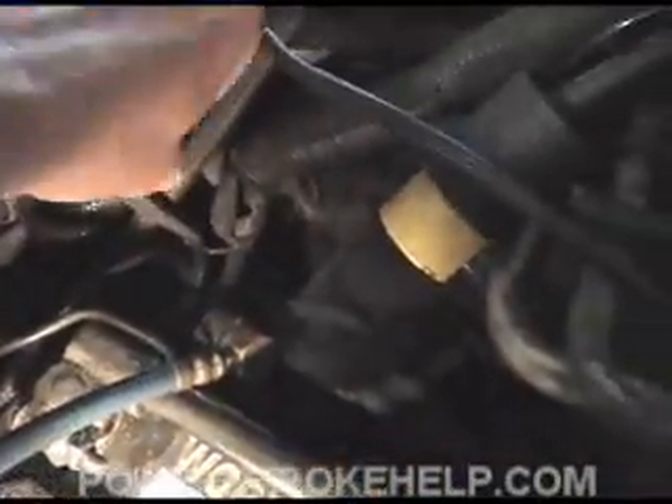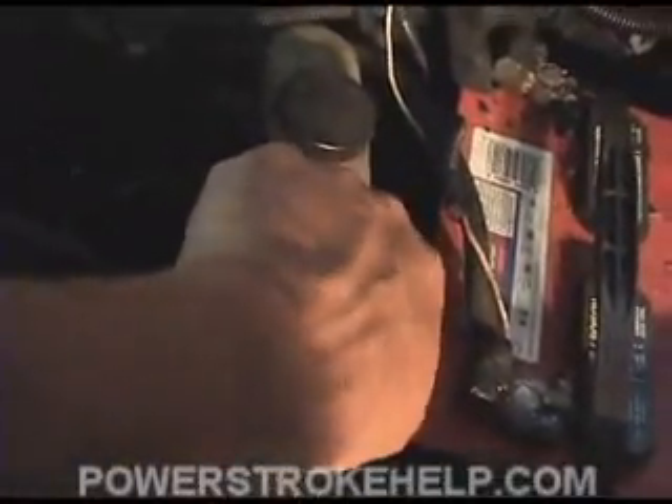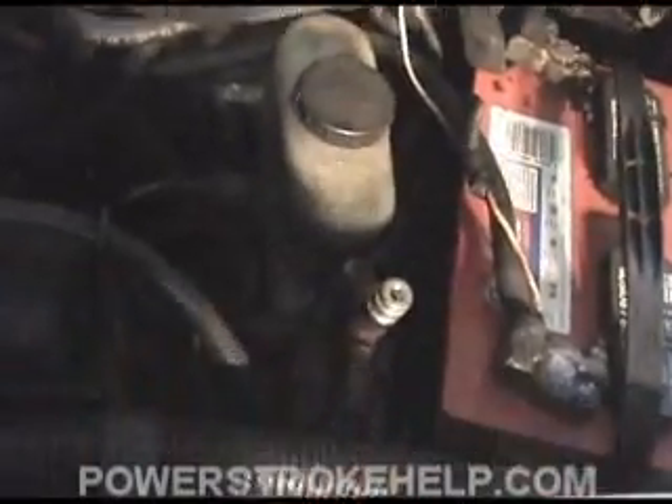It's very important that you don't leave these caps off as you unhook your hoses. You're going to lose a little bit out of the hose, and it's very important you put these plugs back on. You don't ever want to put the hoses on or take the hoses off when there's a lot of pressure on the system. You do not want to take the hoses off while the engine is running.